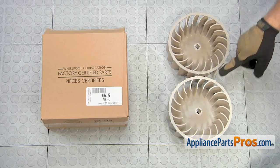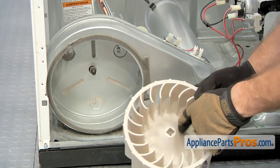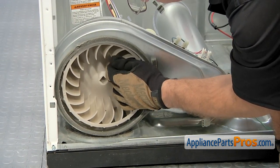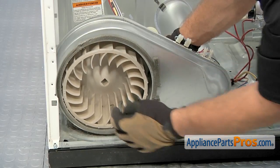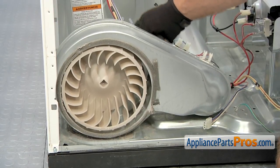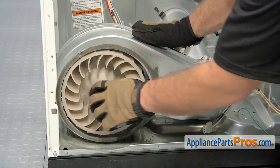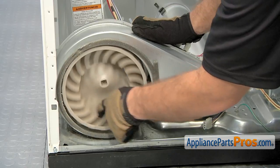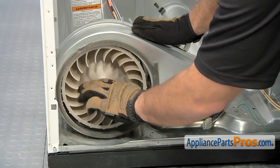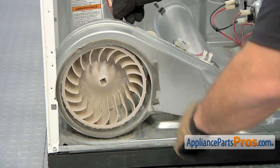Here's the old blower wheel next to the new one. If you don't have one yet, you can get it at AppliancePartsPros.com. To put the blower wheel on, line it up with the shaft and get the thread started. Remember there are arrows — it's counterclockwise, reverse threads. Once you get it started, reach back and grab the wrench. Hold it as you spin the blower wheel down. You don't have to tighten it a lot — just snug it down. Because it's reverse thread, as the motor spins it will continually lock down, so no need to torque it. Just snug it down and pull the wrench off the back.